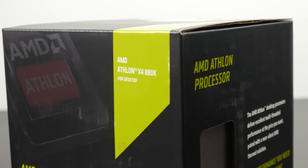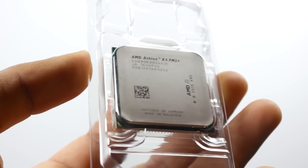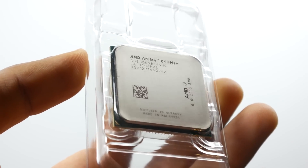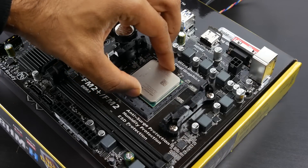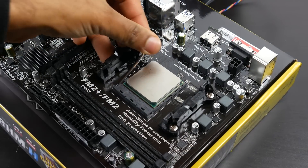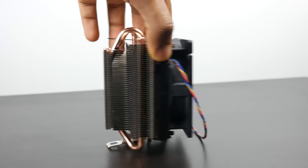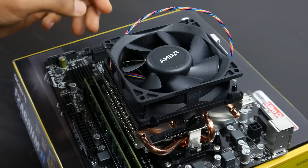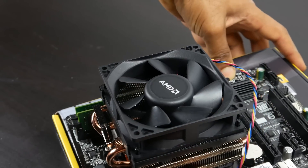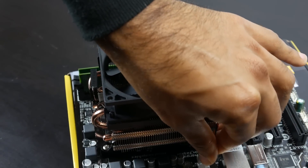The platform we're going with is an 880K paired with an FM2+ motherboard from Gigabyte. The AMD Athlon X4 880K is a nice overall quad-core CPU that's well under $100 and definitely overclockable. We pushed it with the included cooler up to 4.5GHz with the multiplier set to 45 and voltage at about 1.4 volts, and the temperature didn't go beyond 68 degrees Celsius even at full gaming load.